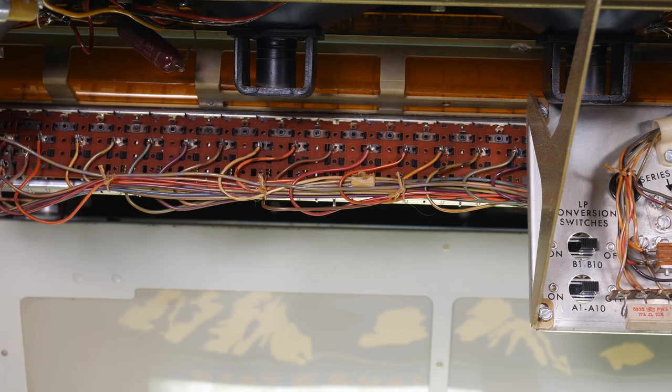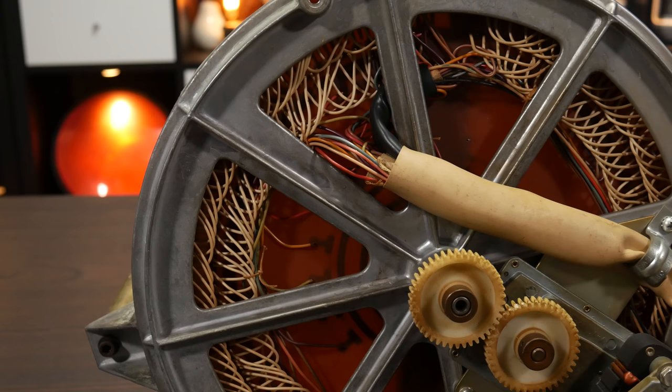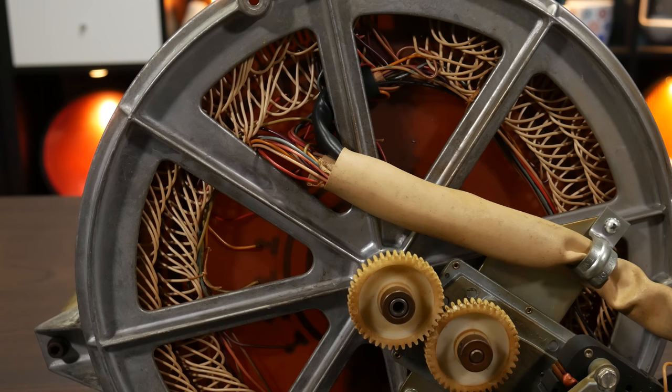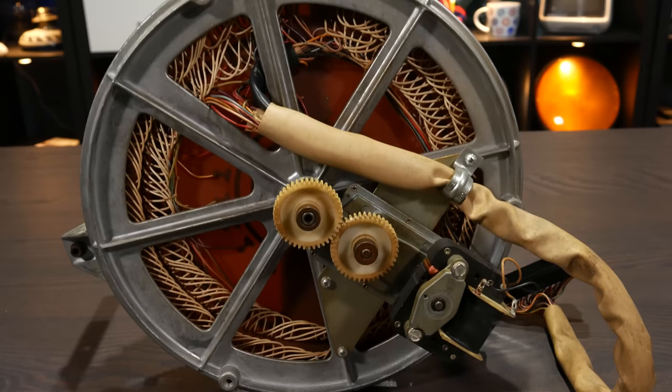In the case of the number patches, they repeat every 10 patches, and you can actually see on the bottom the wiring loom has a ton of ivory wires just looping repeatedly because they only need to start at one of the contact patches and then just loop to the 11th, the 21st, the 31st, the 41st, all the way until the 191st, right? I think that's right.